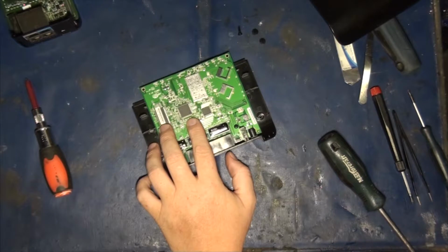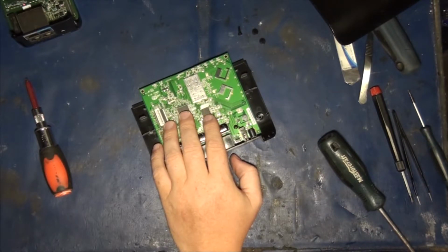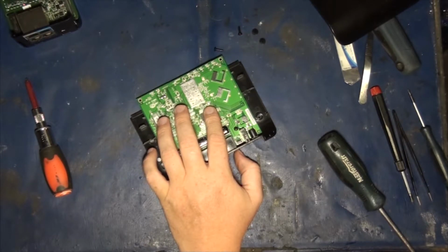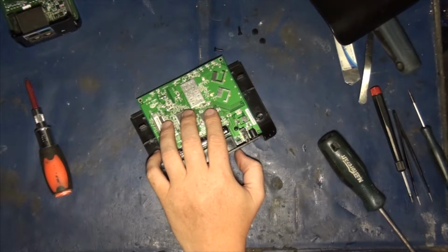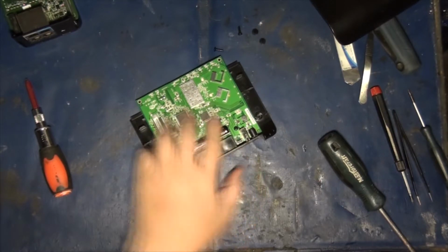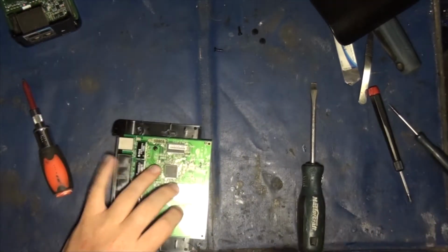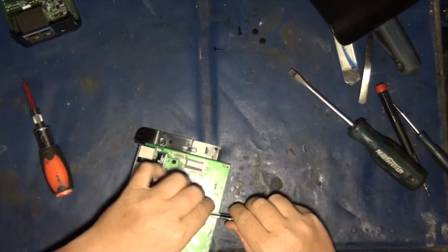One USB 2.0 controller with built-in MAC physical support. High-speed UART and multiple GPIO pins for general-purpose I/O, LED, blah, blah, blah. Single-lane PCI Express 1.1 interface. 802.11n radio, JTAG port for processor control. So yeah, just from what you can see when you log into these guys, they are only SISO. Which means the most speed you can ever get out of them in the best conditions is probably about 75 megabits per second.